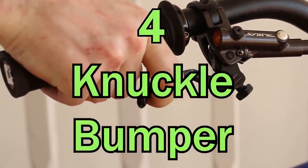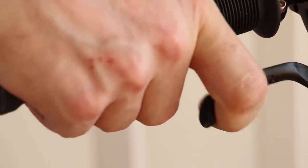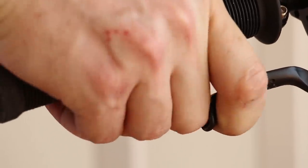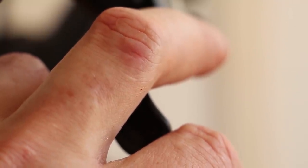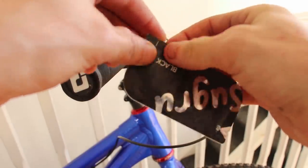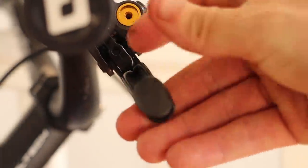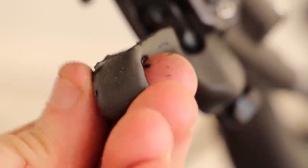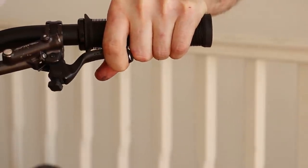Number four: the knuckle bumper. One of the more painful issues is hitting your middle finger knuckle on the brake lever. It mainly happens on the back brake side during a big move when you're squeezing hard but your hand is also rotating around the bars. To save weight, levers usually have a pocket on the back, but this makes them sharper and more likely to cut you. I used to always have an open cut, but since doing this hack I haven't hurt my finger at all — all that's left is a tiny scar. There's probably a few products that'll work but I've had great results with Sugru. It's a moldable rubber glue that you can shape how you want and it'll set into a firm rubber. Just squash it into a ball and press onto a clean lever blade. After 24 hours it'll set into a perfect knuckle bumper, and if you wanted you can even colour match with your bike. No more pain — ideal.